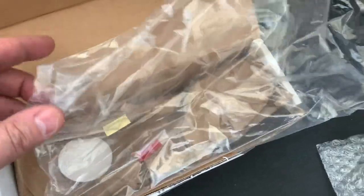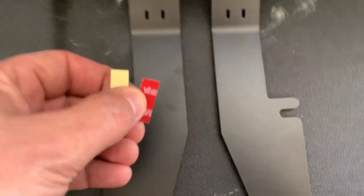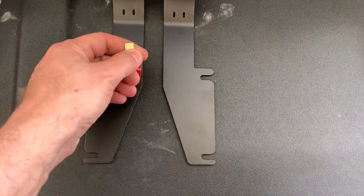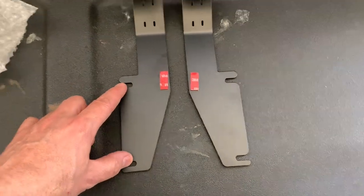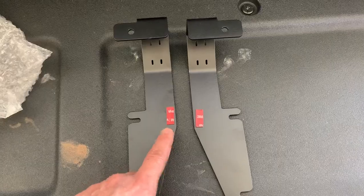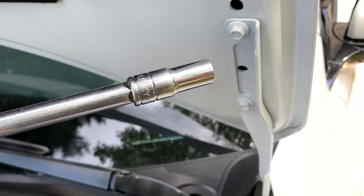Inside the bagger box for Nolo Designs, you're gonna see two little 3M pieces of automotive adhesive strips. You're gonna take your brackets and stick these right there, and what that's gonna do is once you bolt these into the hood bolts, this is going to give you an extra third point of contact. All you're gonna need for this is a 10 millimeter socket and ratchet.